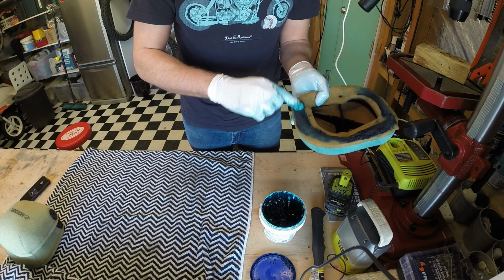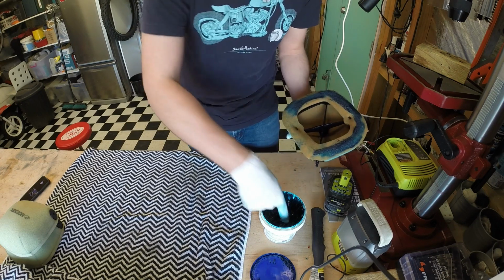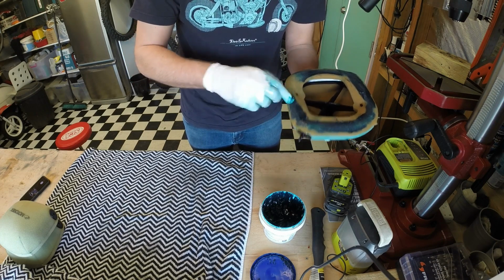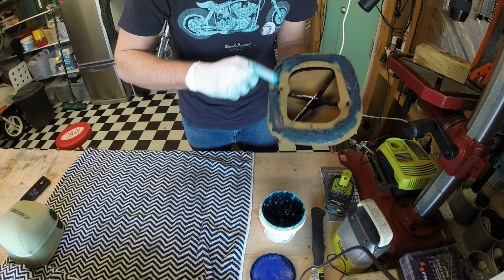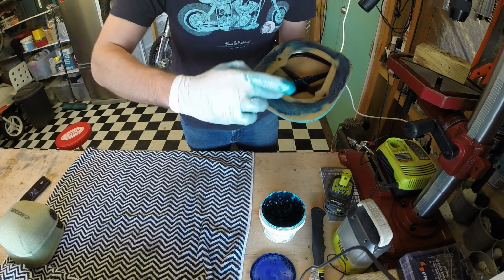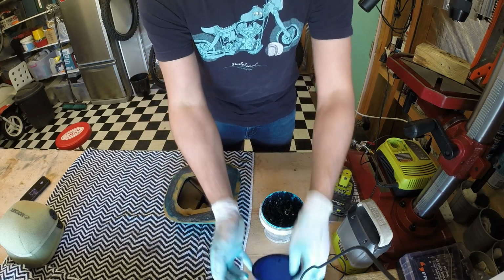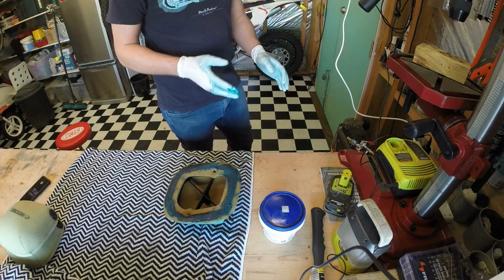Just follow the line of the filter cage that's underneath. When you can feel it, just make sure there's some grease on that, because that's what presses against the airbox. Probably putting too much on this. Not that it really matters. Okay. So that's about all the grease you need. Just try and get rid of any blobby bits so they don't get sucked through. Okay, let's leave that there for now. And fit it to the motorbike.